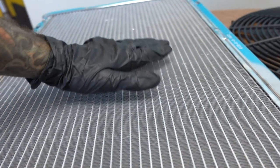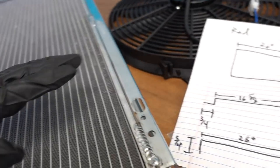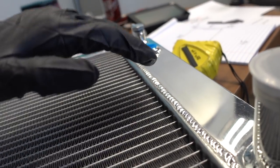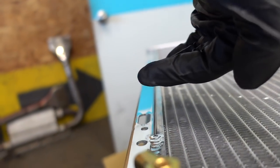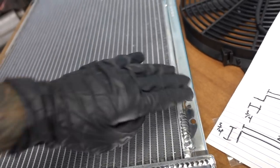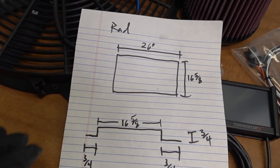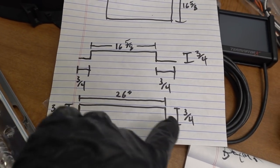I'm gonna make a panel that brake-bends up and comes off the vents here, and then I'm gonna cut a big old hole for the fan. The fan will mount to the shroud so that when the air comes through the radiator it gets sucked evenly all the way through to the fan. The panel the fan rests on needs to be above the radiator itself — three-quarters of an inch off. It's gonna brake-bend down and then over to attach here. Same thing on the other side — two brake bends, one over and one down, so it has a flange. The flange attaches to the bottom and top, and the sides brake-bend over just to seal the radiator.